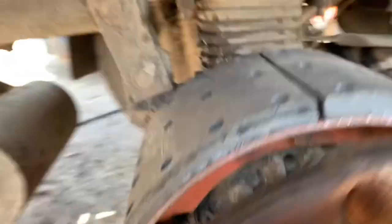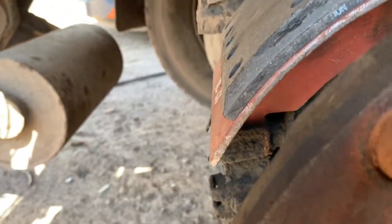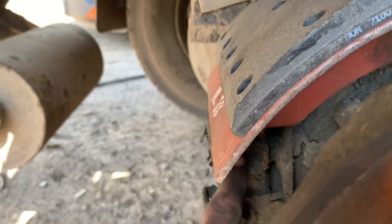Just make sure you've got your brake shoes the right way around on the anchor. Look, that's the shoe with the cut-out bit - that goes on the anchor side, and on the cam side is the big end. So all good.